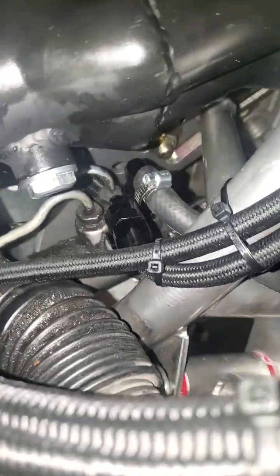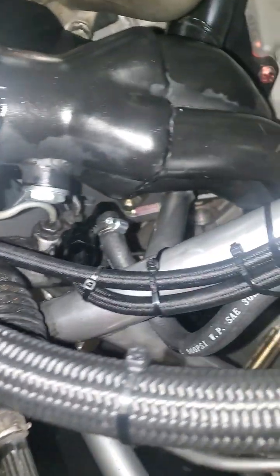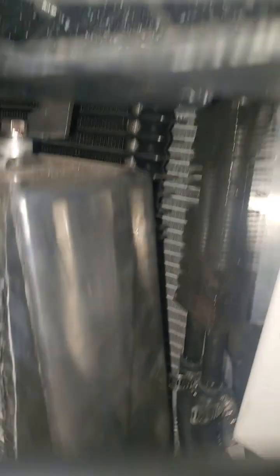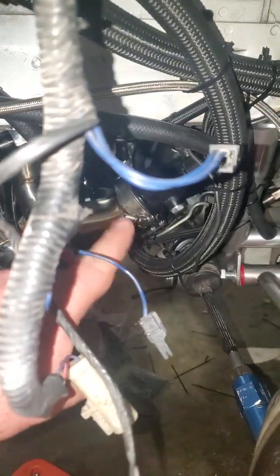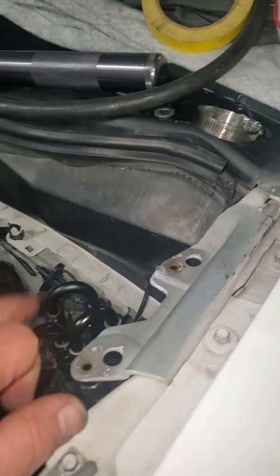I had to rerun my oil lines and make a little change for them. They all run into the power steering rack. The other two lines just run to the front of the rack — one's low pressure, that's why it's got a hose clamp on it, and the other one's high pressure. My lines run out here up front, and I have this power steering cooler mounted right there. Those lines run — one to the low side, one to the rack, and one up to the T fitting. My other AN lines run up here, one is low pressure and the other two are high.